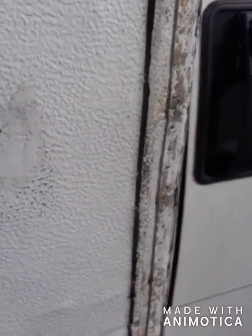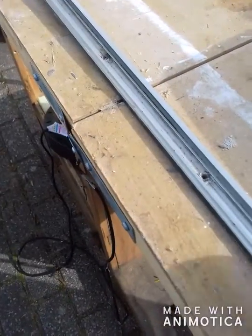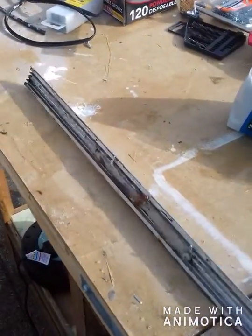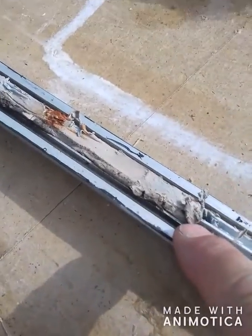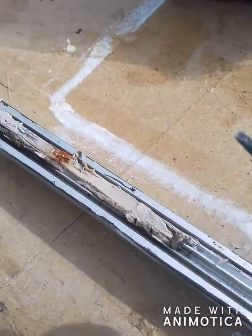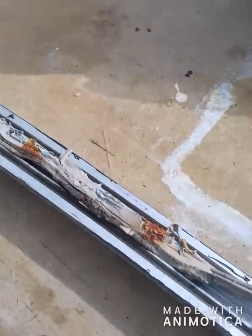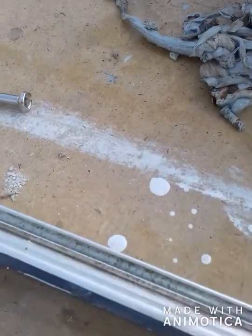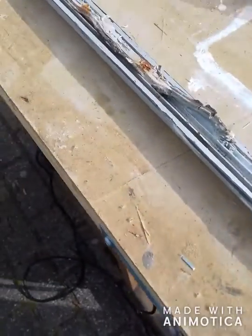Clean up the rail, then offer it up, and try and get some of that rubber on the edge again. This rail — non-setting mastic all in between, all the way down. Basically you just get a screwdriver and it comes out quite easy. To get all that out — this black at the side here, just get it off a little bit, because when I get the rubber on it covers that anyway. Just thought I'd show you how easy it is to get out.